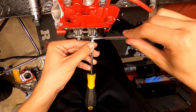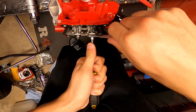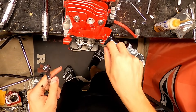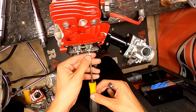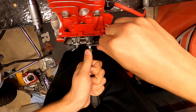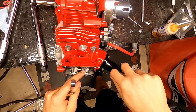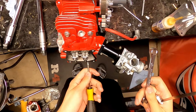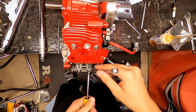That's pretty much all there is to it. This is on a Predator 212, and some bigger motors may have different specs. But on the Predator 212 — both the hemi and non-hemi — the process is the same. With different cams they might require a different lash setting, but on every motor I've seen, stock builds and aggressive builds, it's always 0.003 inches.